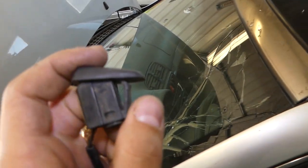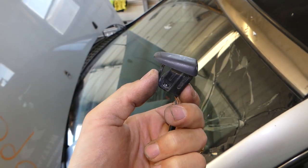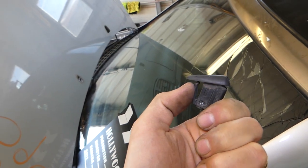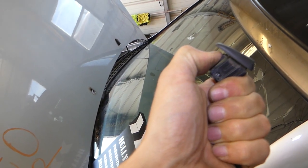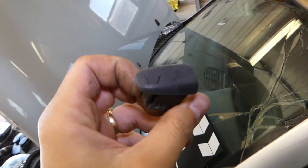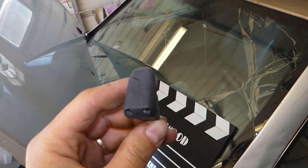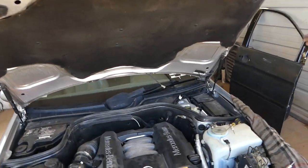This is the spray nozzle — that's the feature I'm talking about. This side faces the front. You need to press that one all the way in to get this end up, then you slide it towards the front and pull it out. That's how you remove and replace those things.